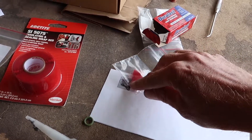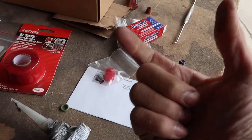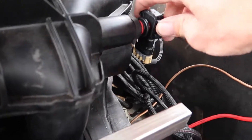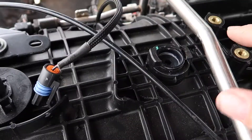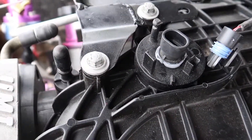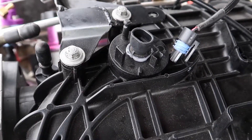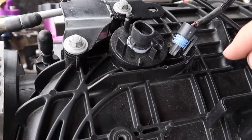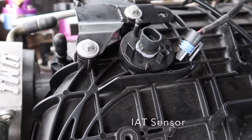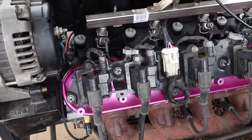I ended up cutting one of these, sliding it over the end of the MAP sensor, and pushing it into that little long plastic piece I had. It's in there and that thing ain't coming out. I plugged this flat-headed silicone piece, and I took a step bit and drilled it out little by little, then tried to blow away all the shavings so as not to get a lot of that crap in it. Got it to where I was happy with it, clocked it, put a little silicone, and it is in there. Then this guy will plug in here.